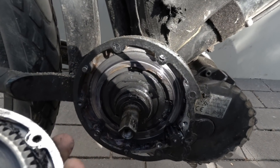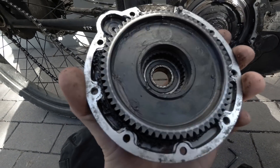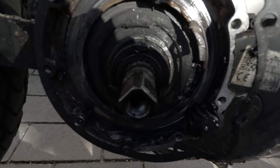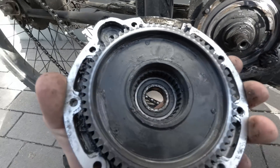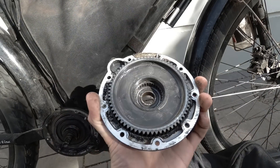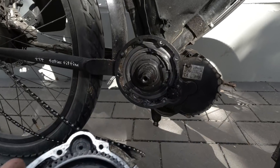There we go. It's not a genuine 15,000 kilometre grease situation because I re-greased it fairly recently, so the grease is quite new. The first thing I'm looking at is the clutch itself - I can see where it's failed, which is good. If the teeth on the inside of the larger gear had worn out you'd have to replace the whole gear. I do have one of those and they're cheap, but I don't want to carry a big heavy gear when touring.